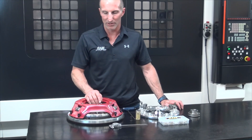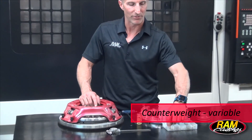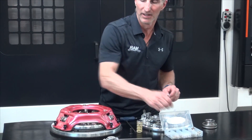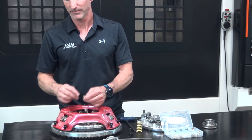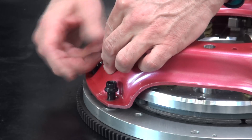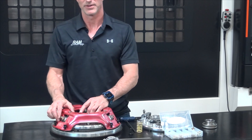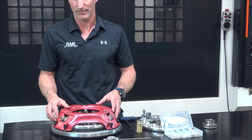The next adjustment we're going to look at is the counterweight. Counterweight is generated through a series of quarter-20 nuts and bolts — steel and aluminum — and these bolts go into the holes at the end of each individual lever. By screwing the counterweight into the lever, you're increasing that bob weight on the end of the lever, so as the engine RPM increases, the force generated down through the plate is going to increase as well.